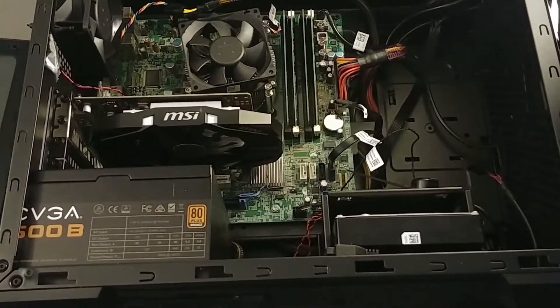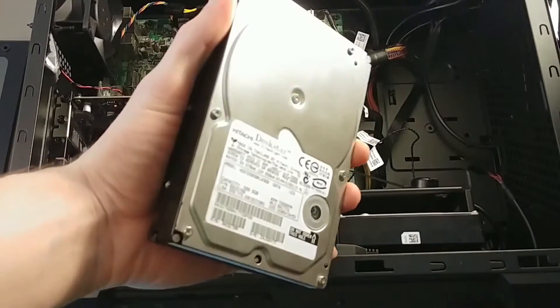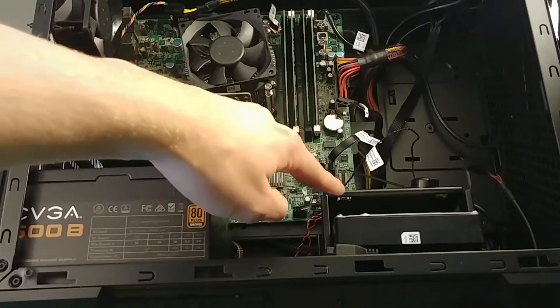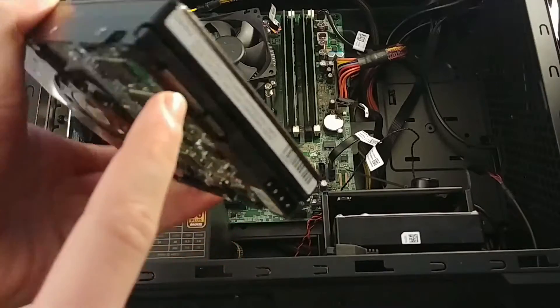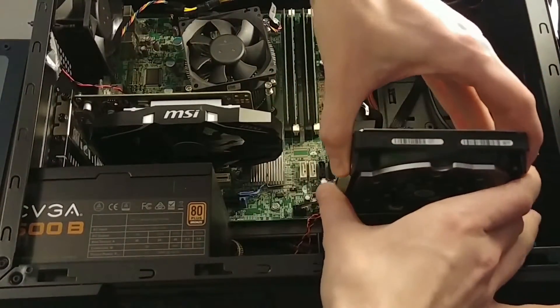As you can see, we already have a hard drive in that drive bay and we're going to be adding an extra one on top of that. This will be going in, and I will be pointing out the hard drive bay we'll be putting it in. We're going to be putting it in with the ports facing towards the back, because we have an extra back panel where all of our wires will be going through.